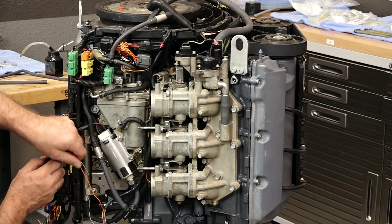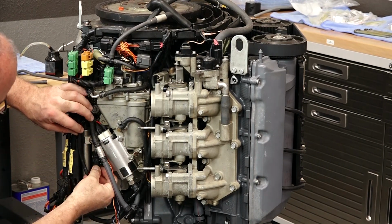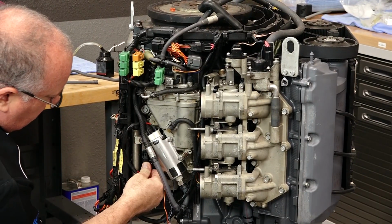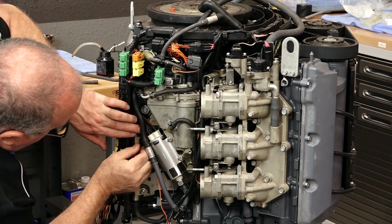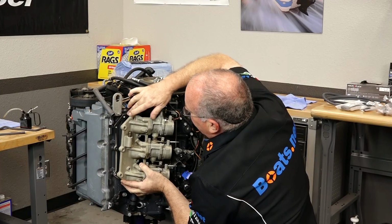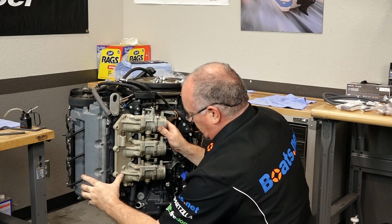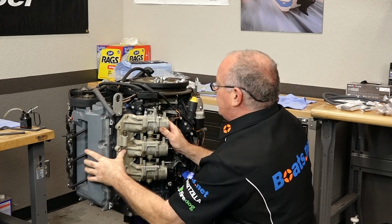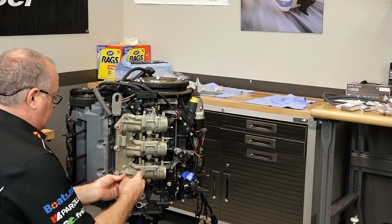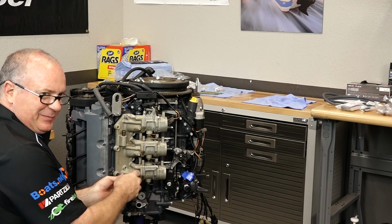Let's get our fuel pump cable, and it goes to that little attachment point right here. Let's go and get the intake over on the opposite side. It's basically the same game as what we just did. There we go. Be careful there. I actually let the gasket slide over a little bit and get off that dowel, so don't make that same mistake.